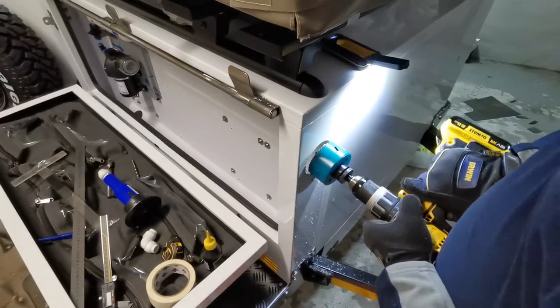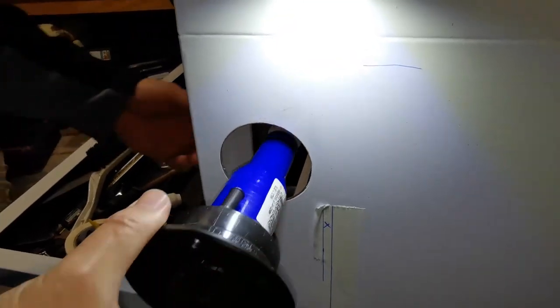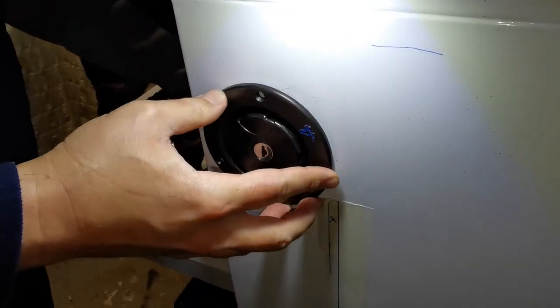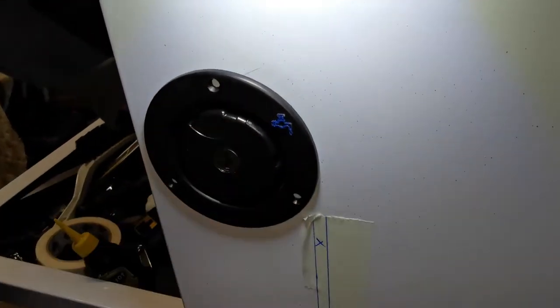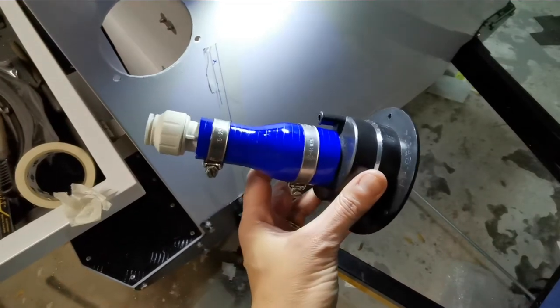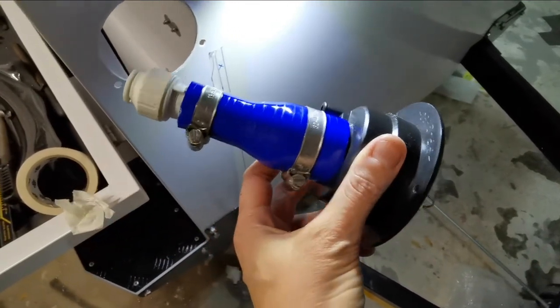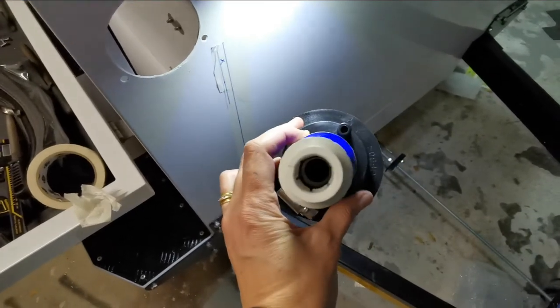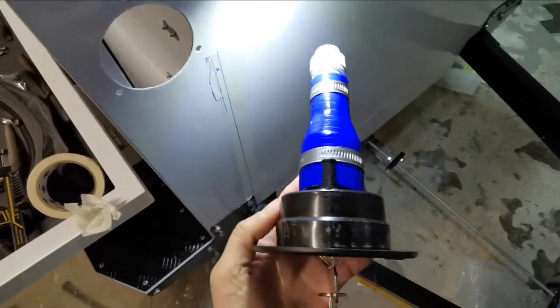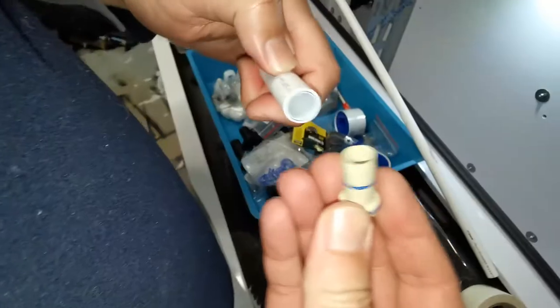The daunting task of cutting holes and drilling into the trailer started — there was really no going back at this point. Wherever we cut and drilled, we made sure to deburr and to paint the exposed metal edges. Here you can see the water filler position is on the side of where the nose cone will be mounted later. We used a silicone reducer to get the pipe diameter down from the filler itself to suit the John Guest and PEX piping we would use for the filler system. This pipe system is very easy to work with and also uses retaining clips to keep the connection secure.